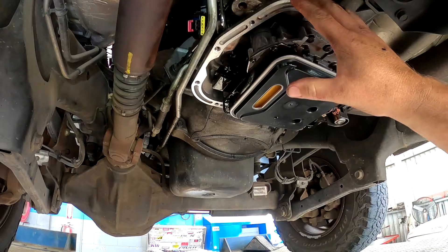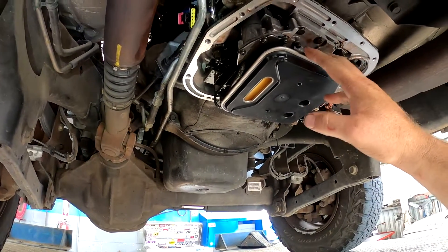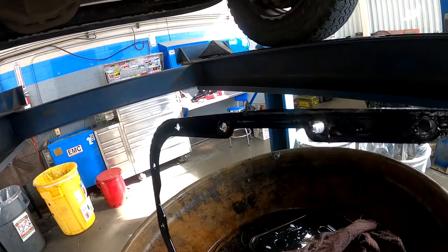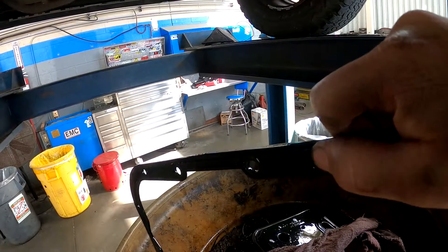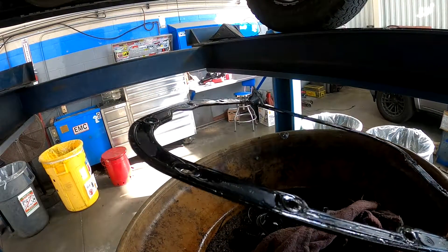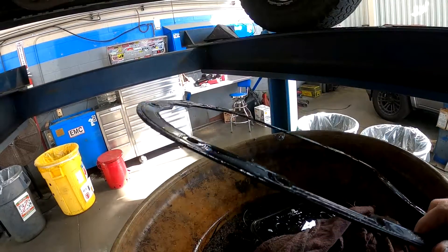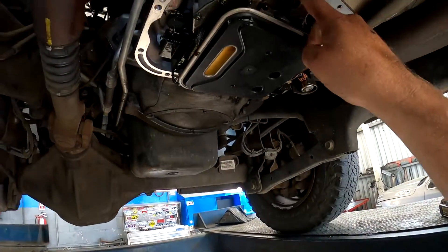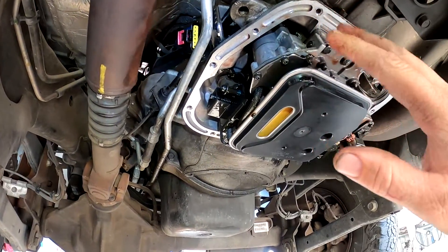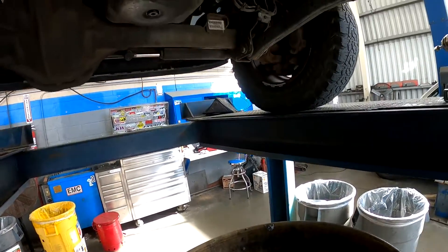I'm going to replace the pan, hardware, and hot tank clean it up. I want to replace the filter — the fluid is pretty nasty, so I'm glad we're changing fluid and filter. The pan gasket itself was pretty flat. It's a plastic with rubber-impregnated gasket, and these do get worn out over time. They technically can be reused, but it's a good idea to replace them every time. I typically don't like using pan gaskets, but in this case this is what the factory calls for — the flange on the transmission case and the pan are designed for it. What you do not want to do is put silicone on this. Let the gasket do its job; the new gasket is going to be plenty fine to reseal that.